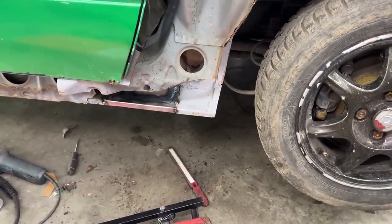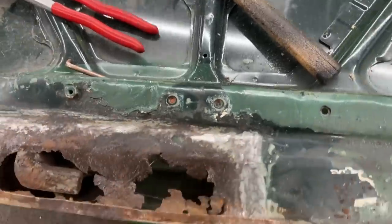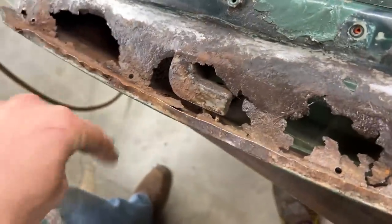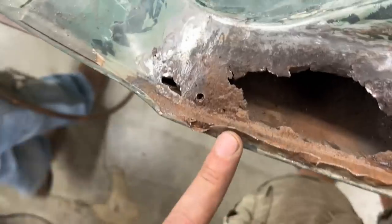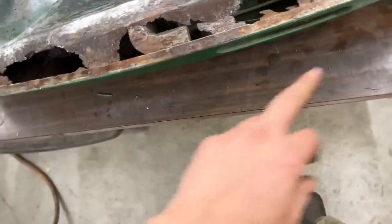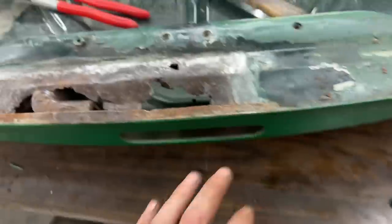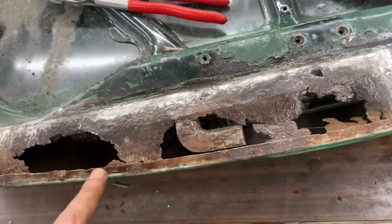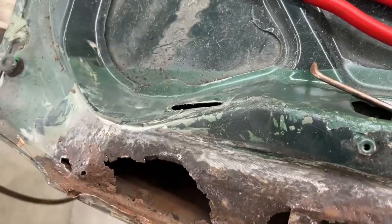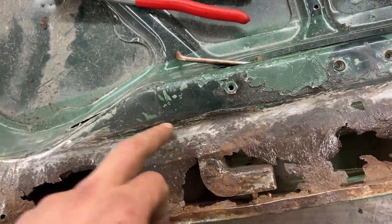While I was welding these patches in place, Nicola stripped this a little bit - he removed the paint and all the dirt from here. I asked him to pull this flange up because we want to get rid of this rust. This flange is really flimsy and I was telling him I don't want to mess with it - we could cut it off and weld a strip inside and weld it on the edge, but we're gonna lose this line on the outside and it's way too much work. I think the flange is not too bad. We're gonna de-rust it from inside. Now I think we should just go and cut it from here.